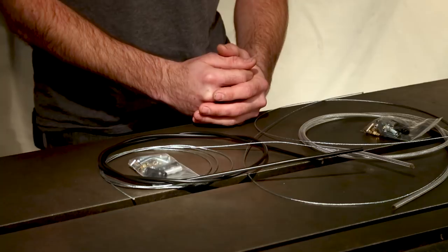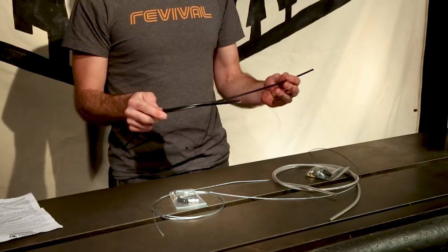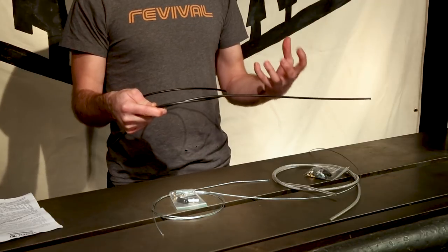When you're ready to actually make your cables, the first thing I'd suggest is to route the outer housing — take this conduit housing material and route it through the bike. Pay attention to a few details: you don't want any pinches, you don't want it to get smashed between the fork and the body or frame. Also make sure that when you turn the bars, the housing doesn't wrap around the steering neck and start to pull, because if the housing gets pulled separate of the inner lining, that's going to actuate the throttle — and if you're going around a corner and the throttle jumps up because the cable binds, you'll probably have an involuntary dismount. Also, you don't want the housing to drape over the exhaust pipe or anything generating a lot of heat — make sure it's not in contact with headers or that type of stuff.